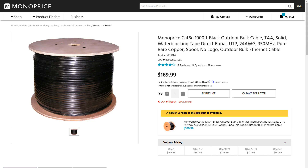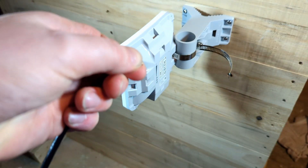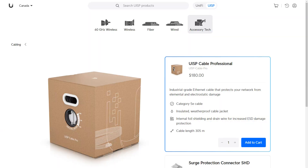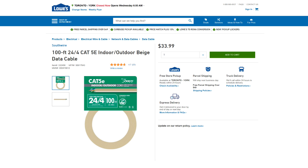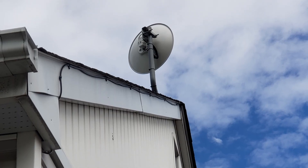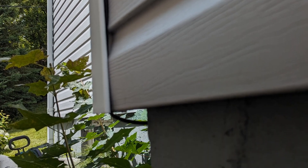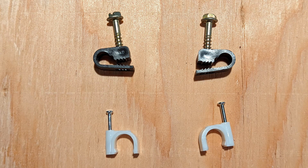Use outdoor and UV-rated solid copper CAT5E or CAT6 cable, because regular indoor network cable will deteriorate in the sun. Getting bulk lengths of unterminated cable is the most flexible option — you can cut it to length, drill smaller holes in your walls, and pushing it through is easier. Bulk cable is typically sold in 1000-foot spools, but some websites like Primus Cables and ShowMeCables, and local electrical suppliers, sell it in shorter lengths or by the foot. Starting from the bridge, secure the cable to the mount to reduce stress on the RJ45 end, and keep a little loop at the bottom so water drips off the cable rather than going into the case.